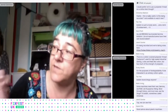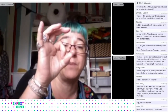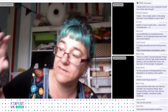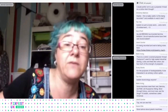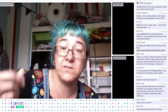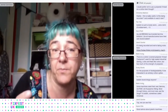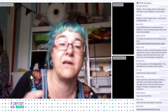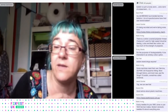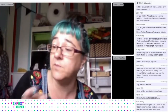And then you've fixed your sewing machine. The other thing that vintage sewing machines usually have is little rubbers, about that big, that go around the bobbin winding mechanism that hooks up to your hand wheel. When you're winding up the bobbin, those rubbers, being rubber, perish. Sometimes they get really super smooth so they're not gripping anymore, and sometimes they're just knackered and you have to replace them. Again, they're just a couple of quid, totally easily findable on eBay. Everyone's still making them. You just need to put in the diameter.